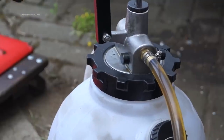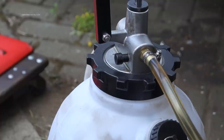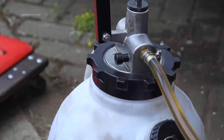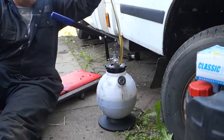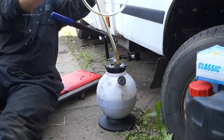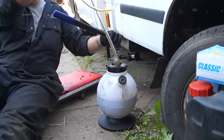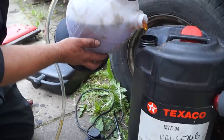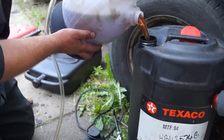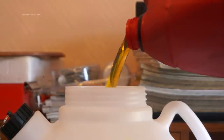In the neutral position — and this is actually an important feature — once you've used the fluid you can run it back from the pipe into the container. If you're going to change the oil you don't need to flush the pipe, so it's less of a waste of oil. You can see the hosing is already empty. I can then put the MTF94 back into the container, leaving me to flush it out and top up with a different type of fluid.